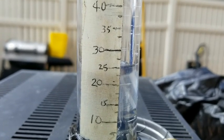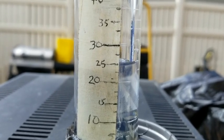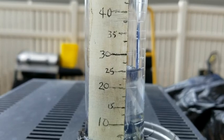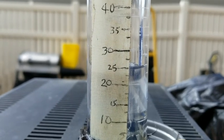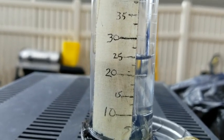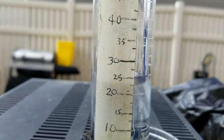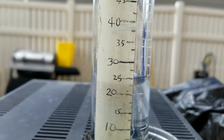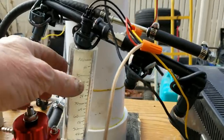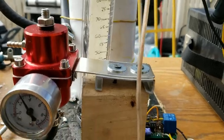These guys are rated at 200 per minute. So I'm guessing that my pressure gauge is off, or that's the best I can do with my pump and my setup. The Honda Magna is rated at 81 horsepower, which requires 123 cc per minute fuel injector. So I think I'm going to use these, just to make sure, and test the second injector on the same bank — they should be identical, but we'll see.